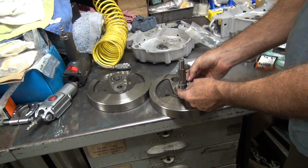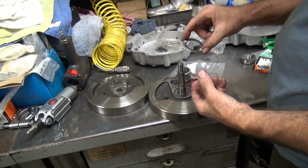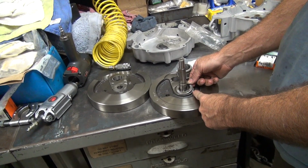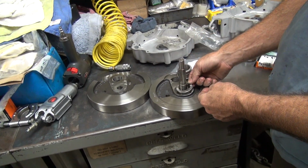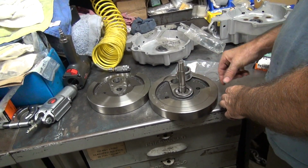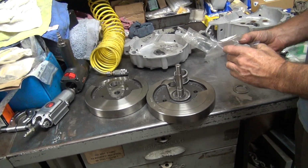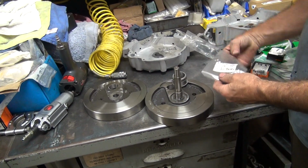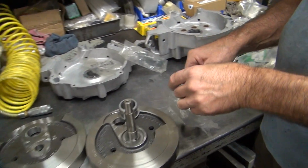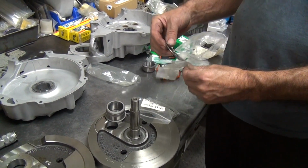So right now I need to go buy some washers because I don't have any washers. I only got one. So it looks like we can use this diameter washer and this die here, bearing. Now if I put a Harley thrust washer in there, that would work, but the problem is it's soft. So this bearing would chew up the Harley thrust washer, put metal throughout the motor. This is a hardened washer, it doesn't wear. So we can't use Harley parts. So I'll have to go find me some washers. So tonight we'll be studying the catalogs and figuring out what we need. Luckily, these are 60 thou thick. So I'll go hunt down some other bearings, some other washers, and order up a bunch of stuff. So that's how we figure this stuff out for now.